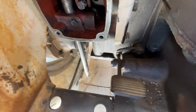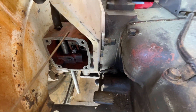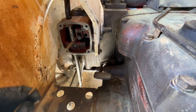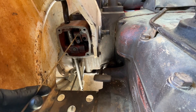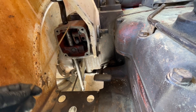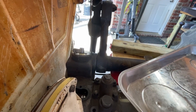I am not going to go ahead and put the roll pin back in the bottom of the parking brake just in case I've messed something up with the quadrant housing and need to take it back off — I'll do the parking brake roll pin last. I've torqued these inside bolts down to 15 pound-feet — that's what I found as a general dimension for 5/16" diameter bolts. It's a half-inch bolt head, 5/16" bolt diameter. If anyone has the actual torque settings for these specific bolts for the quadrant housing, let me know in the comments. In a future video I'll go through the adjustment of this connecting link nut, the spring tension, and the cam plate inside the right-hand ram shaft bracket.